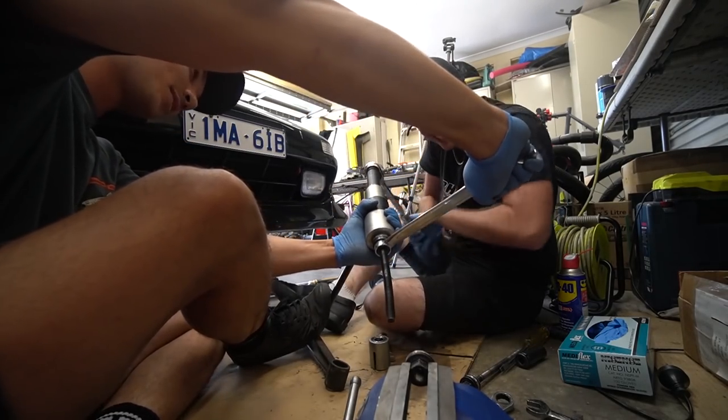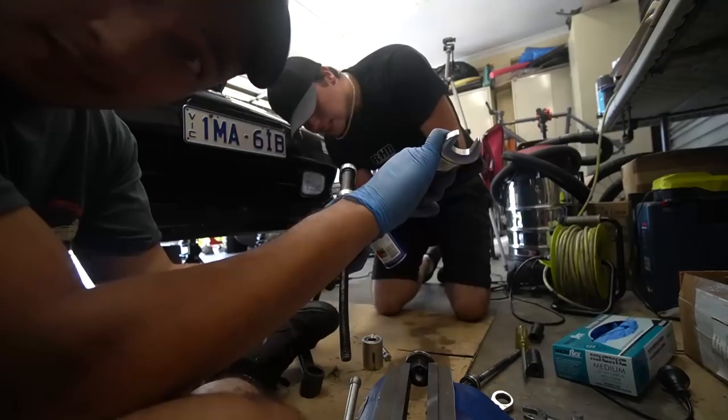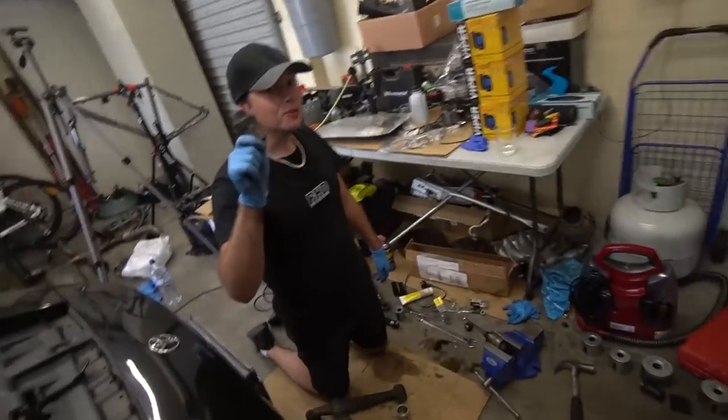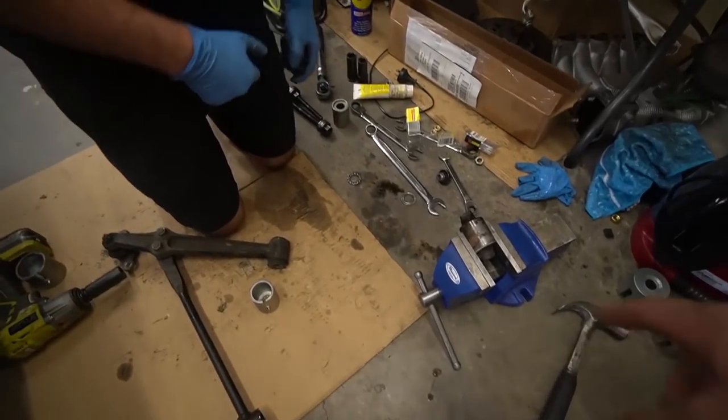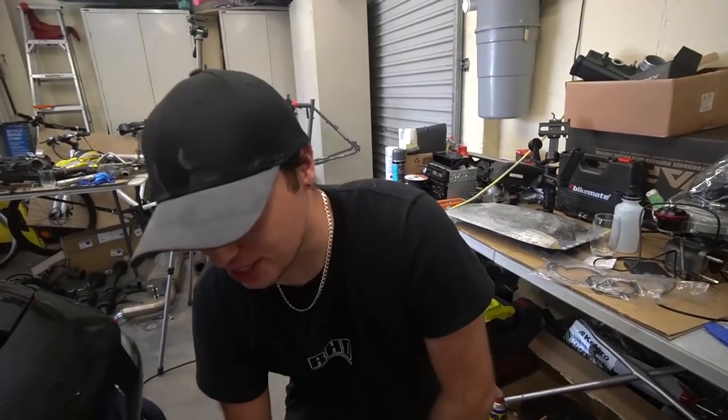You can't do this with one person! Always lube up. Jacob and I have managed to take the hard bushings out - the ones that have a metal ring around them. A lot of people get a saw and go right through the bushing, then start cutting that metal piece to get it out, but we managed to use the press and took it out in one whole piece. These are the two hard ones. Something I noticed about Rex's bushings - they're all pretty bad.